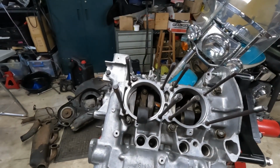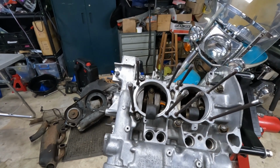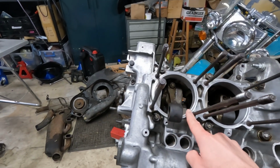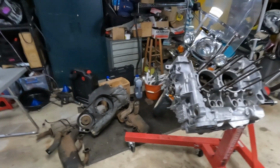Right before the surgery, I had placed a jug on both of the 1 and 2 cylinders and a piston inside, and calculated my as-built deck height, as well as calculated what my shimming should be at the bottom of each cylinder to attain about 40 thousandths of an inch in deck height, which is the recommended standard from the Bentley manual and the members on the Type 4 forum on Facebook. So I went ahead and ordered some shims for that.